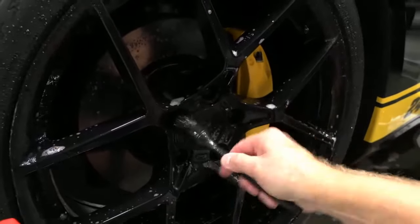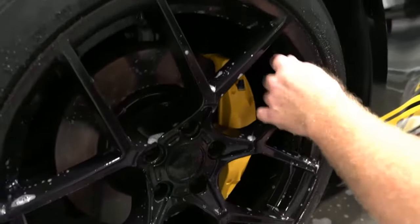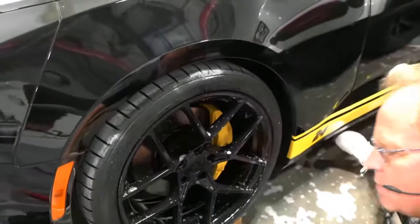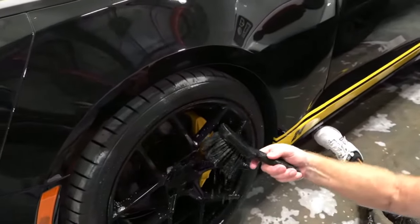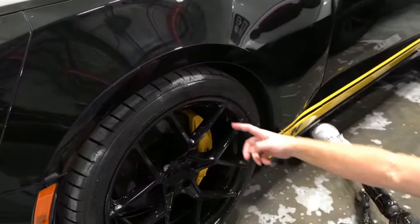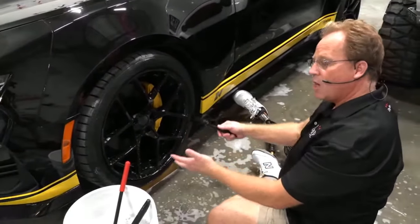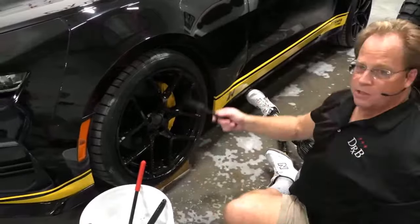And I also like to use this on the valve stem. Now, look up here, Yancey. See that flexing? Here's another important tip. When you're cleaning someone else's or your own car's wheels, you've got a brush, don't ever knock that with the brush. A lot of times these are made in other countries, and with exposure to ozone, the rubber rots, it dries, and they're brittle, and it'll break right off. And instead of detailing the car, now you're changing a flat tire.